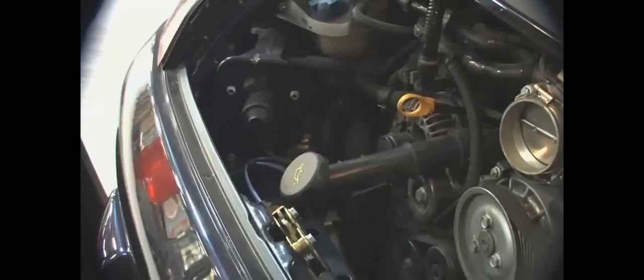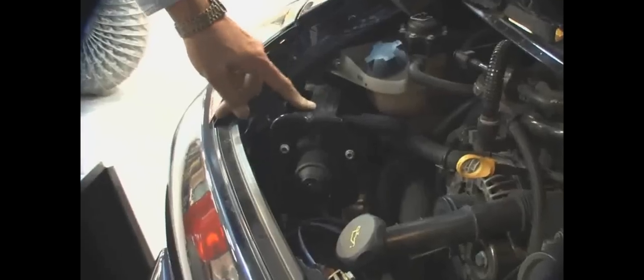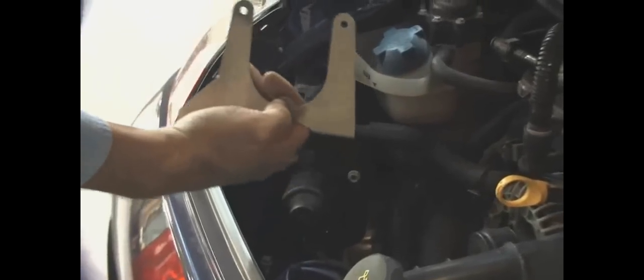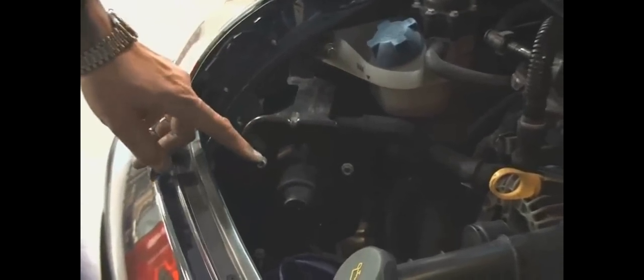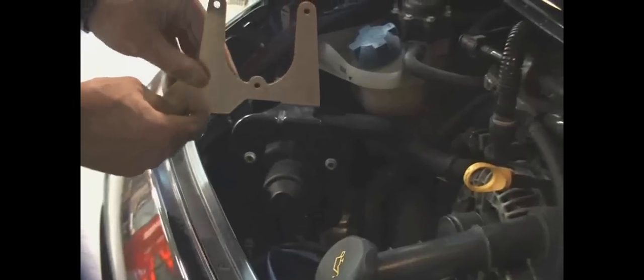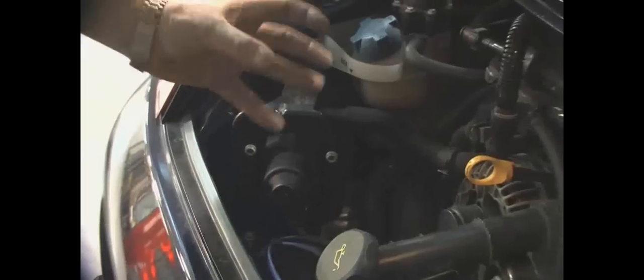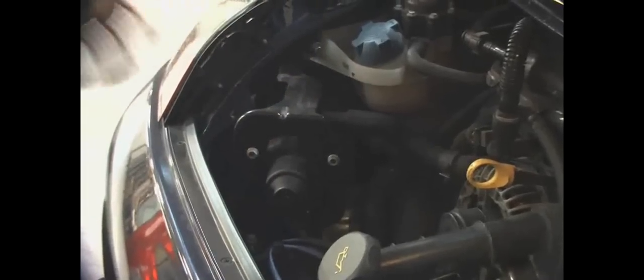The next step in doing the FabSpeed cup air intake for the 996 cars worldwide is you have to remove this black painted bracket on the air pump. This is an air injection pump that pumps fresh air into your engine. We made this new stainless steel bracket and there are five 10mm nuts on here. You remove all these nuts, unplug the wiring connector, and this pump will bolt to this precision stainless steel bracket, which sits the pump back further in the chassis. That way our cone air filter can sit right here and get cold air right from outside the engine bay.